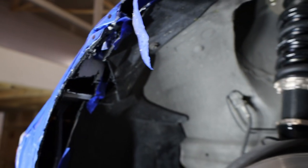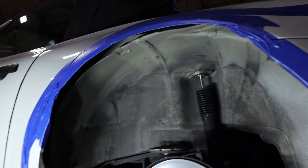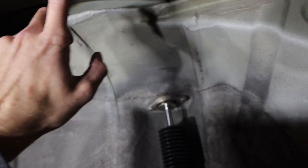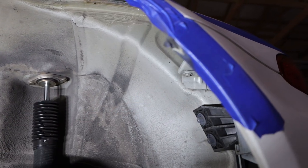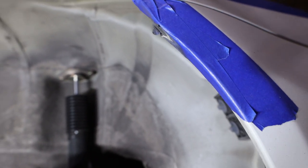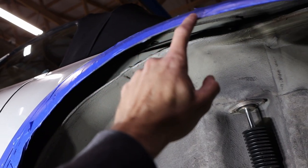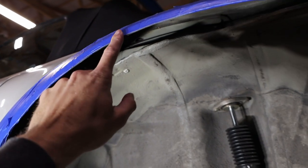In the rear, same kind of thing on the top — it was nice. I actually pointed my mirrors down and I could watch the tire, and most of the time I had plenty of clearance. It was just on those really big bumps where I saw and actually heard a little bit of rubbing. You can see right here the tape got rubbed off just right there in that portion — nothing back here. And then a little bit back on the rear bumper — I kind of knew that was going to happen. I might just trim it a little bit; it is just plastic and it's flat so it's not going to really hurt the tire much. On the back here I will cut this a little bit further up — I can't go too much more because I know where I want my new fenders to sit, but I'll cut that a little bit right in that area where it was rubbing.